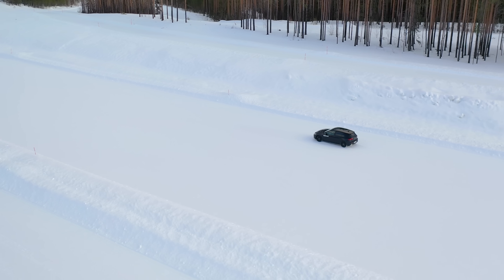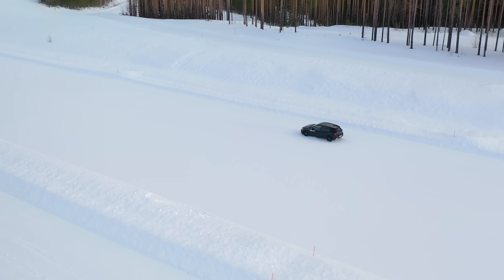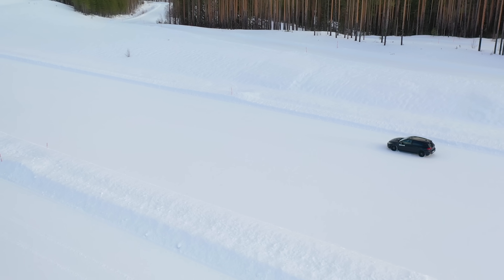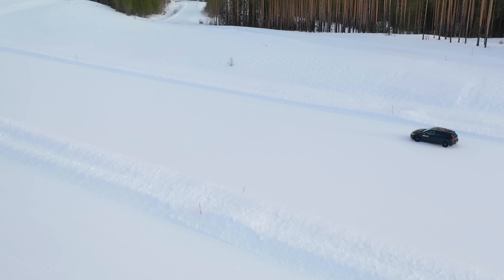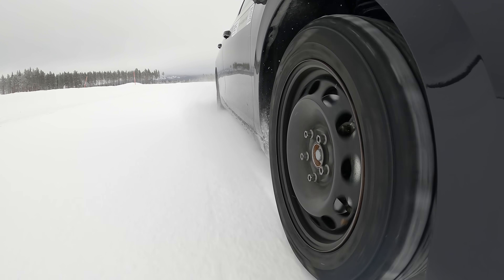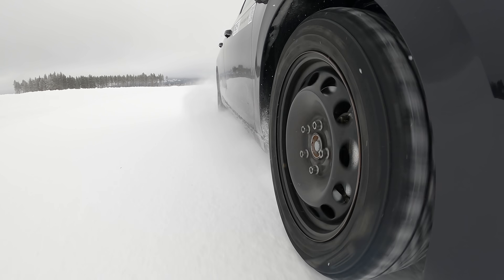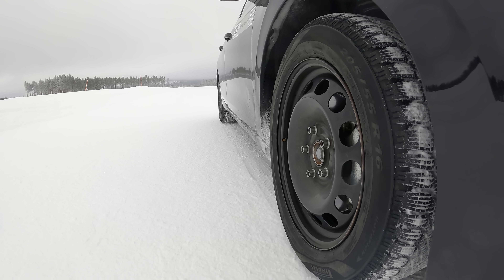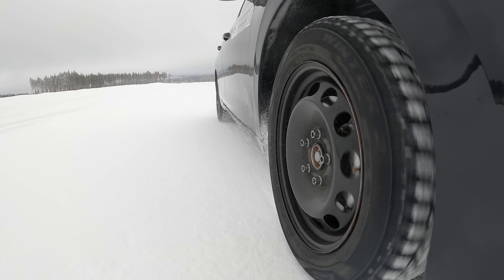For the acceleration, this is a manual so I'm measuring from 5 km/h because the first little bit of acceleration is just a bit random as the traction control kicks in. I'm ending at 35 because that's just before the red line so there's no influence from shifting gear. Then we're braking from 40 — that's about 45 on the GPS — down to a stop. Once stopped, I roll slightly forward to get fresh snow not messed up by the ABS, and then we go again.